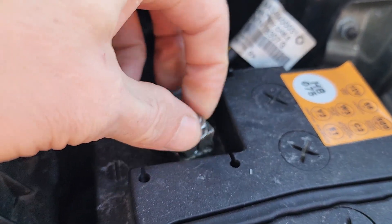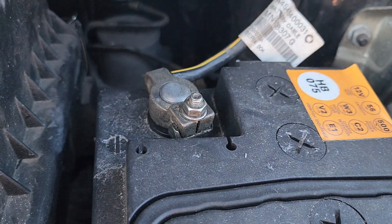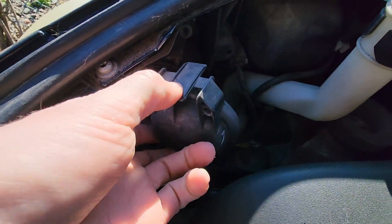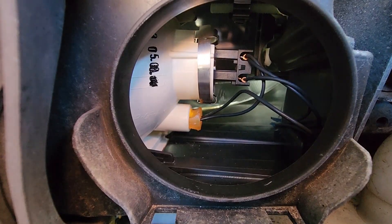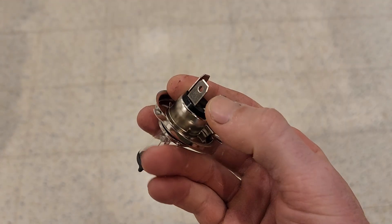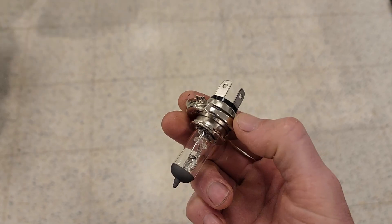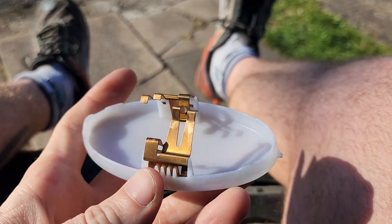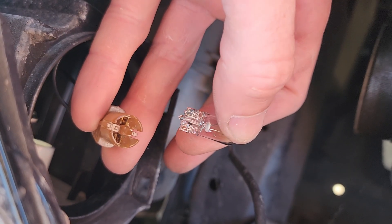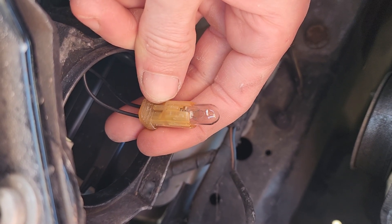We do want to protect both battery terminals from harsh weather conditions to prevent oxidation. For headlight, tail light, or interior bulbs, if you're already having issues apply a thin coat to the terminals — a very thin coat. We don't need to dollop it on just because we have a packet from AutoZone. Those little packets can last multiple months. Just a very thin coat. Once you've applied the thin coat, insert the bulb into the socket and wipe away any excess grease that is pushed out afterwards.